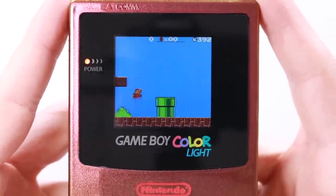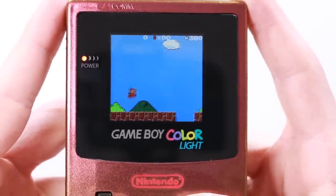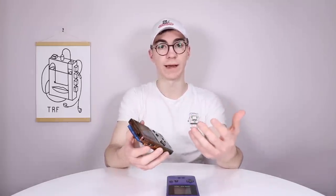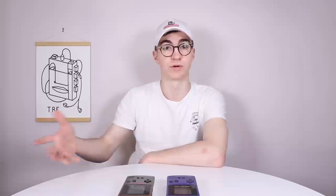There's no ghosting. It's got a thing called a transflective display, which basically means that whether you're inside or outside, it's going to be a very, very nice screen — when you go outside it reflects light, and when you're inside obviously it's got a backlight emitting the light. One of the standout points of an AGS-101 is a distinguishable black screen, but if you play an AGS-101 outside you're going to need a torch to see the screen because it is very, very dim. And that's what was previously being used for the Game Boy Color backlight mods.